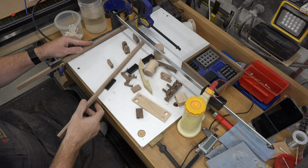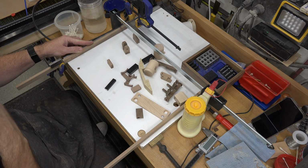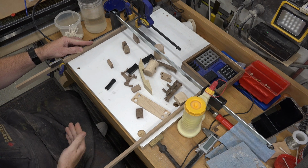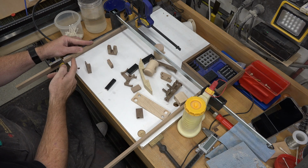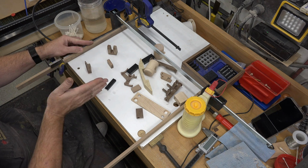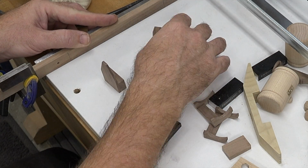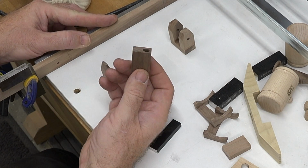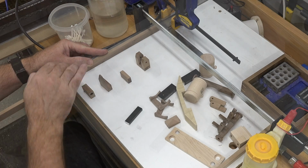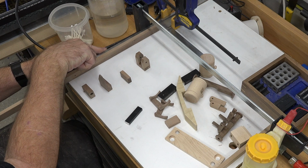We're now going to put half of the frame together. Guys, there is a procedure here that will help you. You just need to know what it is. So what I've done is any component that goes in between our 2 frame pieces, I have them ready to go. Things like our hitch mount and this rear spring, that sort of thing. We have our exhaust holder. You need to have a flat surface, which we have here. We need our reference point, which is our flat steel edge.